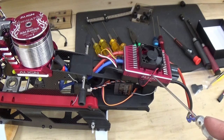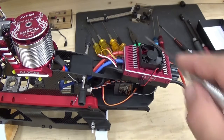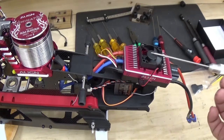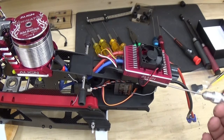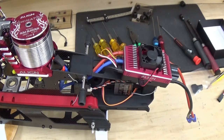There's Velcro currently holding the speed control down. When I'm all done, I'm going to take at least a single zip tie around here just to secure it. The fan is mounted on the ESC and plugged into the programming port for power. This port can also be used with the Align portable ESC programming system, which we'll cover in a later video.